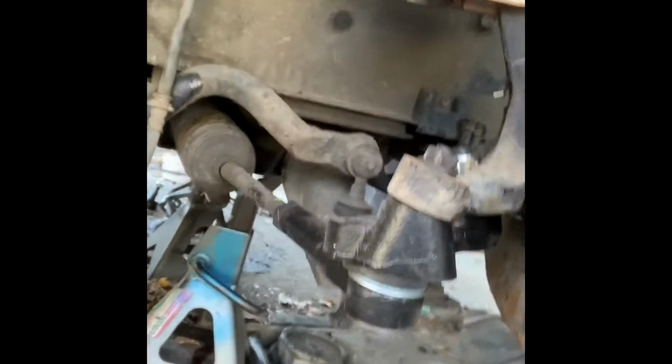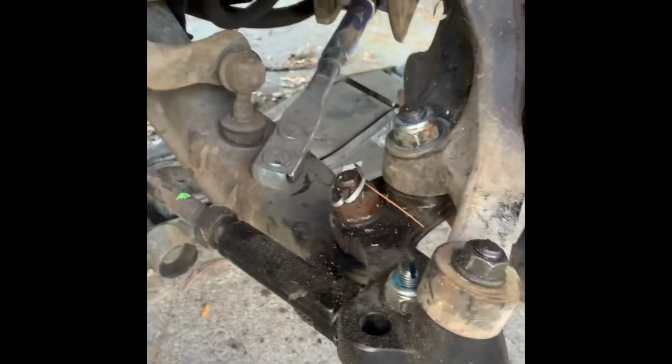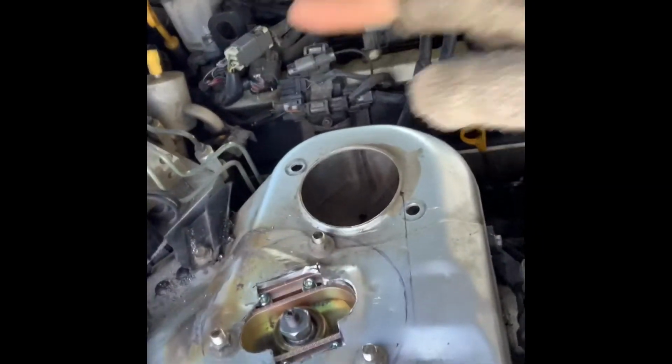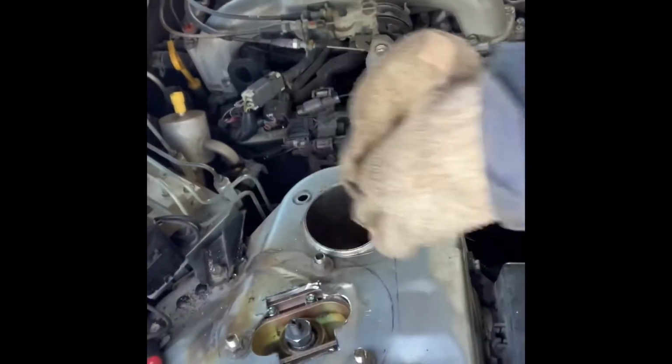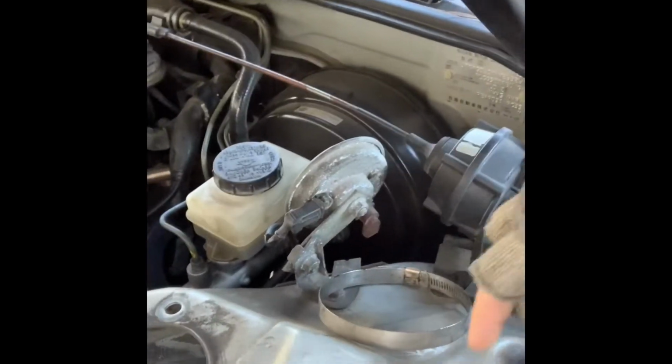We're using a 1995 Nissan Quest outer tie rod end. That's a lot longer than an S13 one, so that works. Got a good amount of angle. We're gonna make a new 1/4 inch plate on top that looks nicer, but if I can get the alignment right with how this is, I'm gonna use the measurements to make it right. We're gonna have to heat all this up and hammer it up like the other side and get all this put back together.